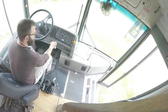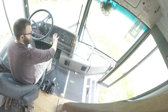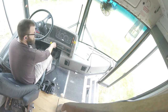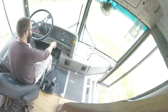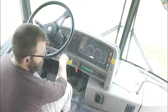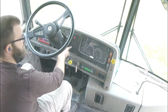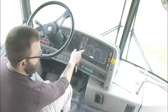I'm going to turn this on. What happens is the odometer shows up, and then after it does a function test on the gauges, it says 0.0 volts — which I understand to be ECU voltage. So we're still having a no-start condition. Let you see the gauges dance and listen to the air alarm. We have communications with the transmission controller here, which is good. Zero volts.